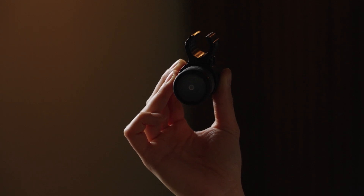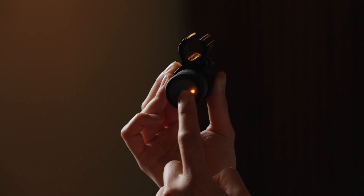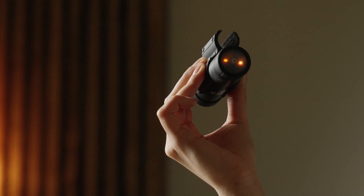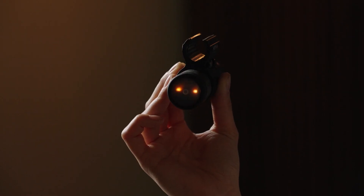To initiate the camera's Wi-Fi mode, start with the ShotKam off, hold the control button for three seconds, then release. Once the ShotKam is in Wi-Fi mode, you'll see two LED lights. After a few seconds, one will be orange and the other green.